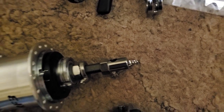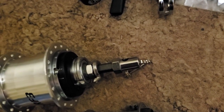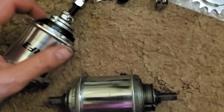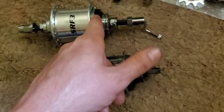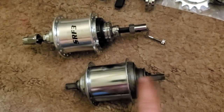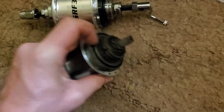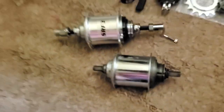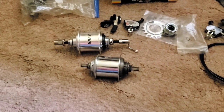It's called the HSA-121 — it's somewhere in my pile of stuff here. The HSA-121 is a newer ball ring that uses the plastic ring and the bearing race. What it does is give you 20 points of engagement on the drive side and the non-drive side. If you use it in the shell, the HSA-121 will still fit on this clutch and inside this hub — it just won't have a way to really hold oil or bearings when it's pressed on the shield.